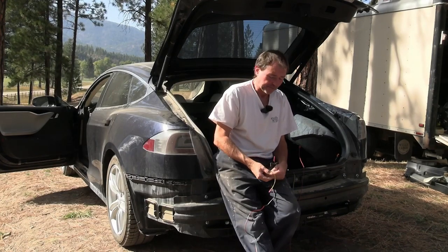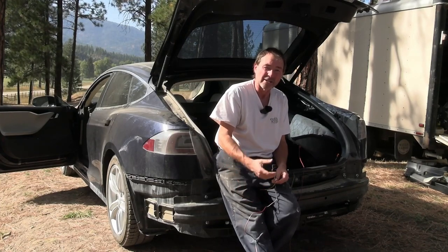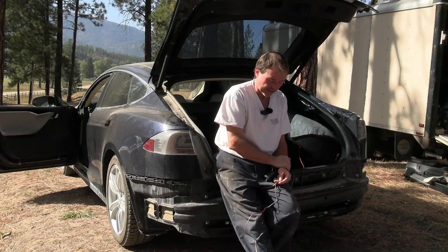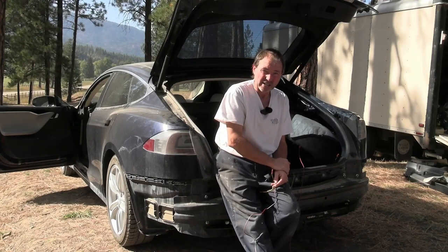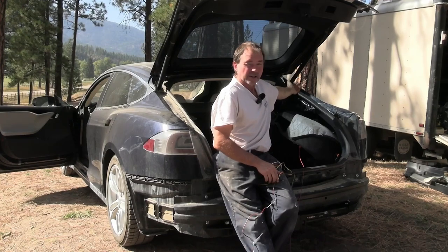Now that said, you've got to be careful. I looked back here to see if that color wire would be back here, and sure enough, I found that license plate wire color back here. Then I looked in the schematic again because it was plugging into the tailgate controller. Sure enough, there is a different wire for the tailgate that's the same color as the wire for the license plate lights. So you want to be careful. You want to make sure you find the correct wire in the harness, and it's not back here. You've got to go up there, because it goes right up to that corner where it goes into the tail light.